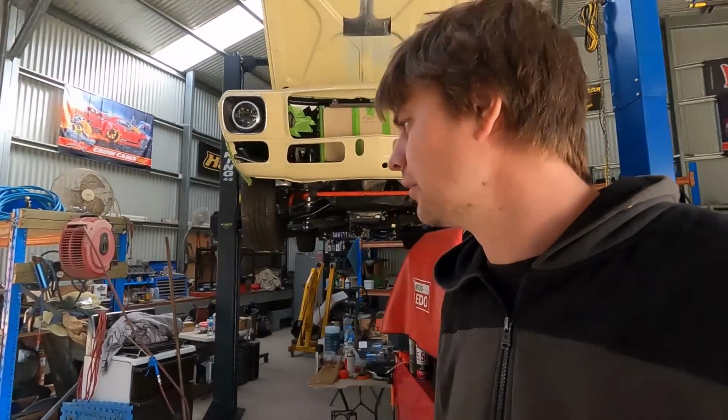Seal Tight, I don't even know where it went. I had it out a minute ago, anyway. We're gonna have to dump the coolant, flush it out, and run it with water with that in it. Hopefully it seals up that hole. All we can do is try, because we're not going to be able to get that radiator sorted today.